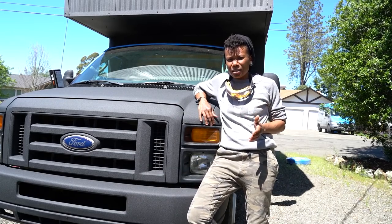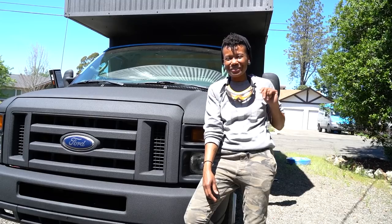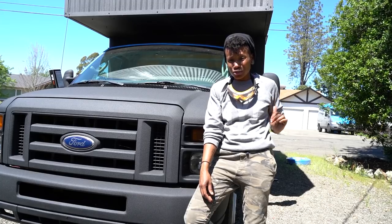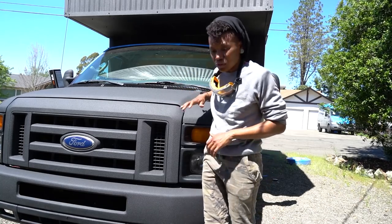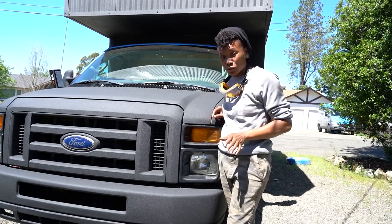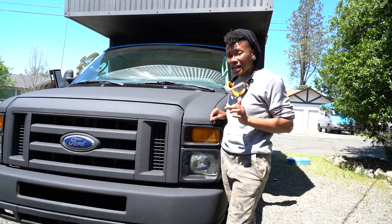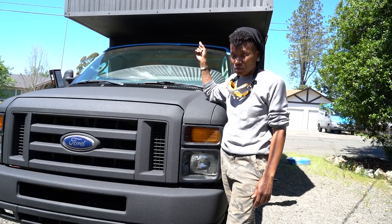The parts of mixing the paint and attaching it to the gun were really simple — almost impossible to get wrong. It was the parts you had to do before you painted that made this job difficult. Before I could even start the process of painting the truck, I needed to rough up all of the paint surfaces — anything I was going to paint I had to sand to get rid of the gloss. The entire truck had to be sanded, and not just the parts with paint — I also had to sand the corrugated metal at the top.